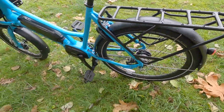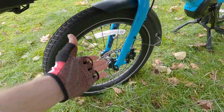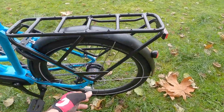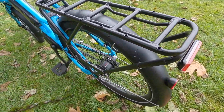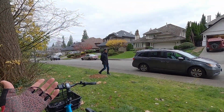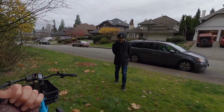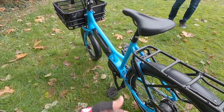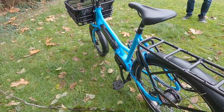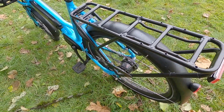So, kind of typical setup, and I might as well highlight, up here we have 100mm hub spacing, 9mm quick release skewer in the back, 135 with a 12mm keyed axle for the Shimano E5. And I think this is an e-bike specific internally geared hub, right? From Shimano, because it's E, so it's like extra torque rated. 60 Newton meters is not like the highest. These days we have 85 Newton meters from Bosch, 90 Newton meters from Brose and stuff, but that's still more force. So it's great that this is e-bike rated.